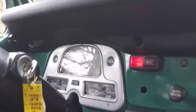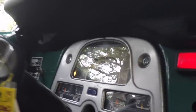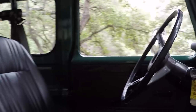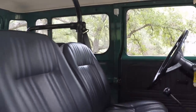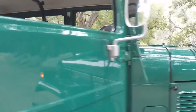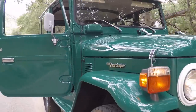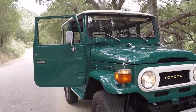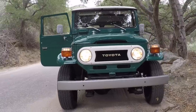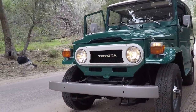With this truck, here are the highlights of the work that we decided to do. We replaced the radiator, the water pump, the thermostat, all its gaskets, the fan belts, and the hoses as needed. We tore the front axle assembly down to the housing and fully rebuilt it — Birfield seals, knuckle bearings, new rotors, new clips, new pads, all the way through.